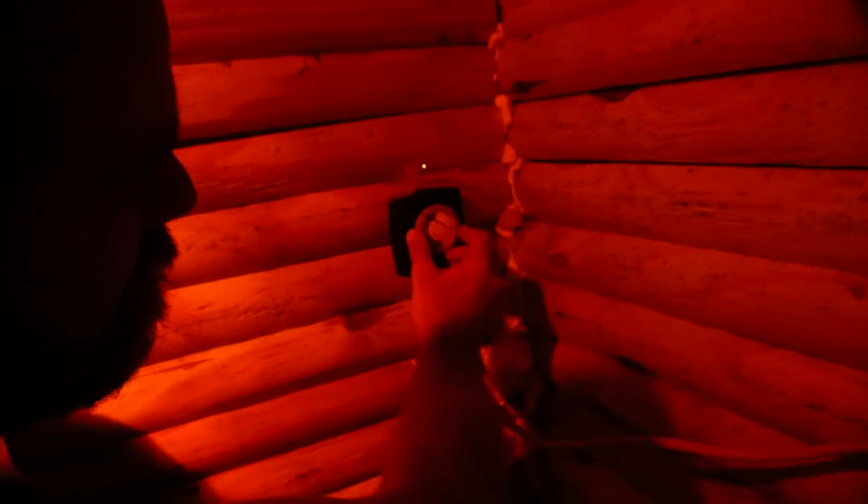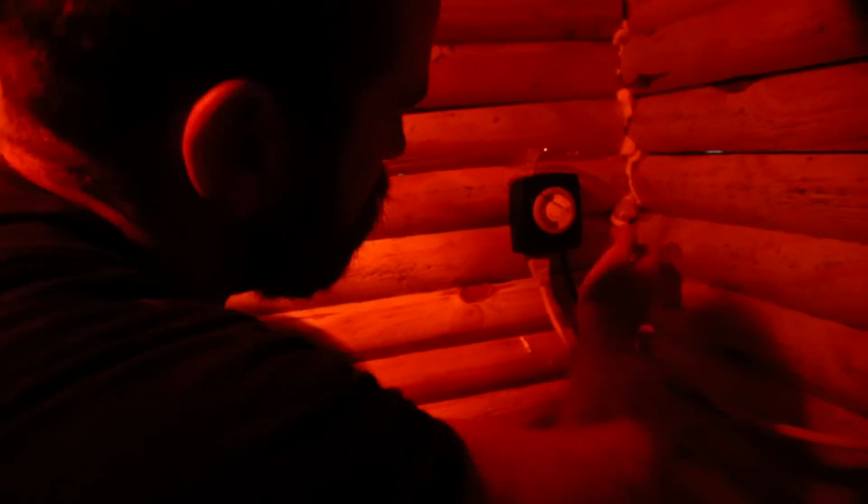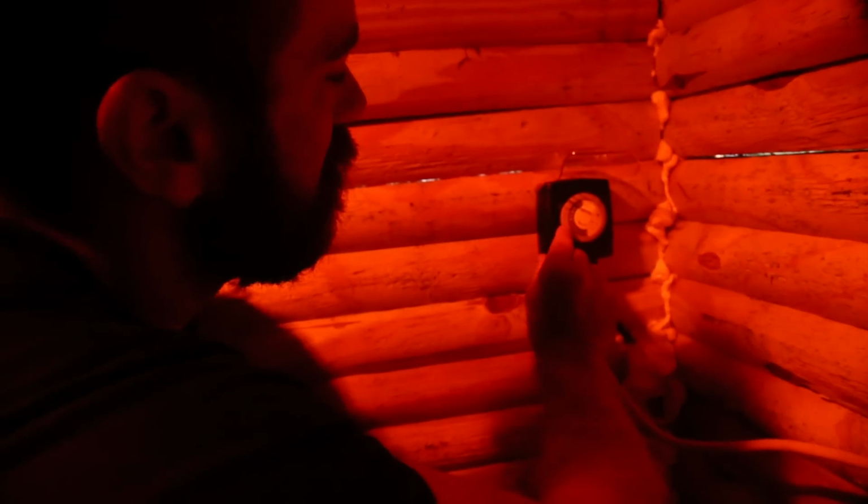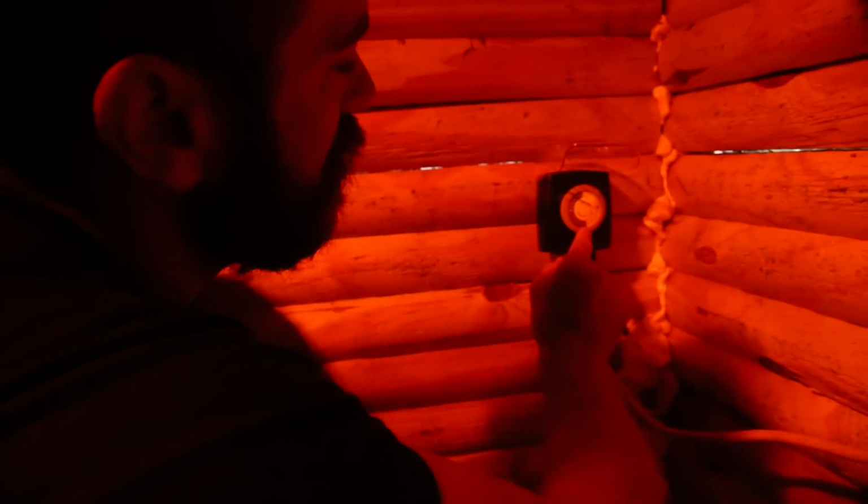So I'm going to set this right now. What you do is you pull all these out, then you depress and set your time. It's about 9:30, so I set it to 9:30. Now, what time do I want this to come on? Well, around 10 o'clock at night we want the lights to come on, so I'm going to press them from 10 until 3 or 4 in the morning. We're going to have them shut off at about 7 a.m. So that'll be it. And then there's a little switch here, on, off. You can manually turn it on and off.